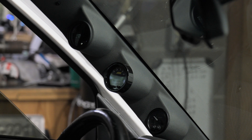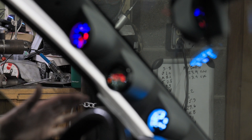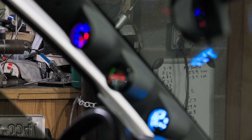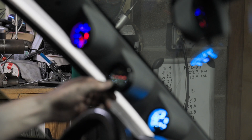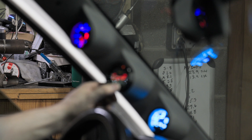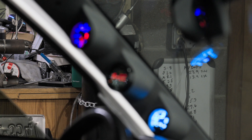After finding out I had a short in my heater wire, let's try this again. We found the LSU 4.9, going into the heat cycle — let's see if we get all the way through and get our full lean reading so we can do our free air calibration. There we go. Sensor's good. FR02 — Cal. Confirm free air calibration. In progress. Free air Cal — and pass.